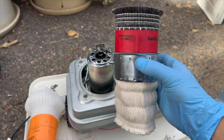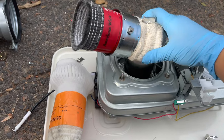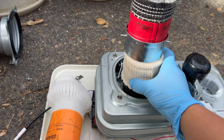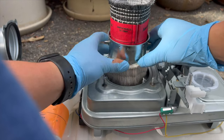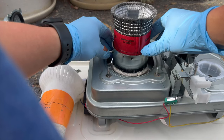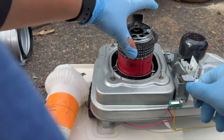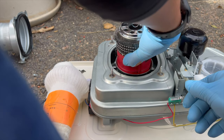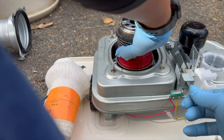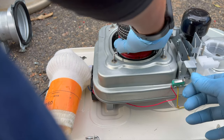Now that the new wick is on the wick holder, go ahead and install it. As you're bringing it down, make sure the wick isn't moving from its aligned position — bringing it down will also help hold the wick in place. Turn it to line up the pins to put it back on. It's the same procedure: wiggle the lever up and down while at the same time turning counterclockwise to install it.